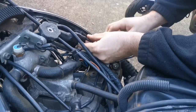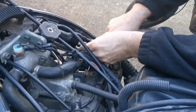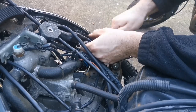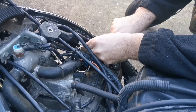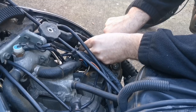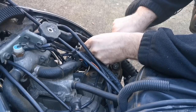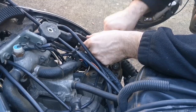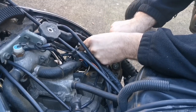So that's great. All we have to do is put in the new spark plug, which we're not going to see today actually, guys. We're going to see that tomorrow, because the spark plugs aren't here. The other things we should be looking at are the middle two spark plugs weren't even attempted to be removed. I'm going to spray WD down there and let it soak. We're not going to remove them. They're working, so it's fine. But when the next person is ready for this bike and ready to service it, the WD that I sprayed down will work its way through, and that will help them out. They should not get the same issue again.